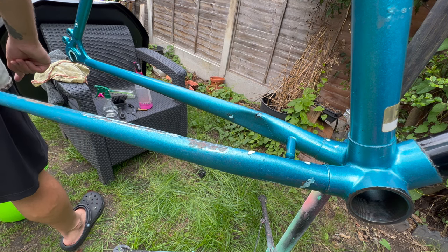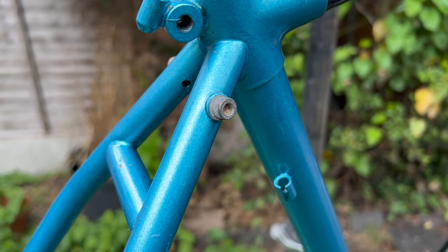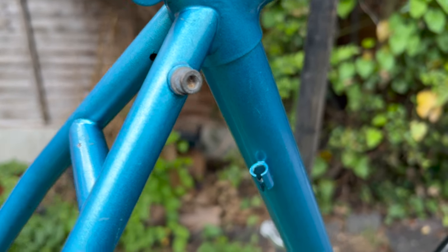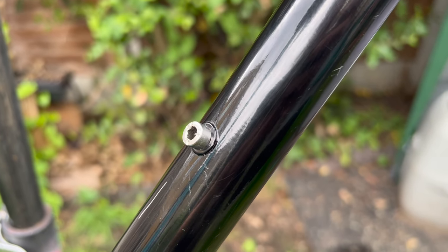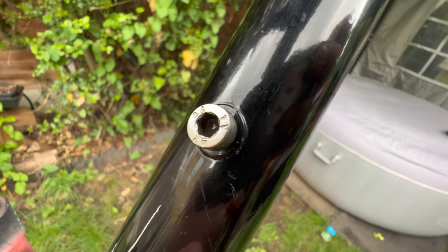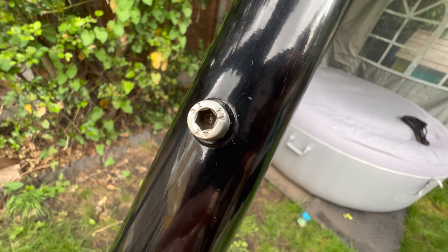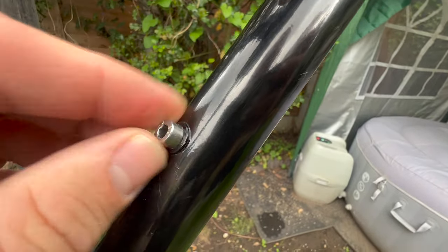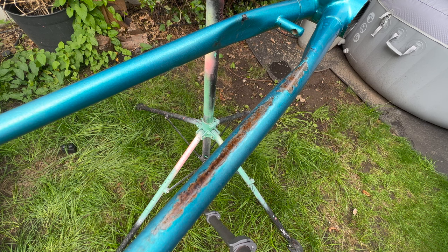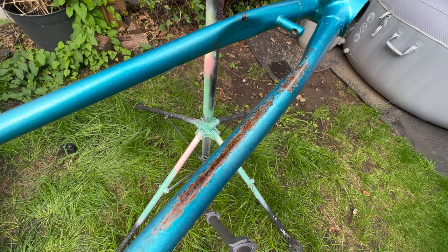I was having a look at the bolts on the bike — I was just going to remove them — and I noticed this one here was quite rusted and quite old. But the one on the titanium part of the frame was pretty much brand new looking still. I can only assume that those bolts themselves are titanium as well, and that's why they still look really good. The other ones are just normal steel bolts. So I'm going to keep these two and then replace the rest. The rust converter wasn't working quite as well as I wanted, so I'm going to use a bit of paint pen just to fill it in and protect it a little bit more.